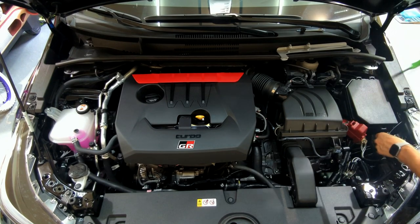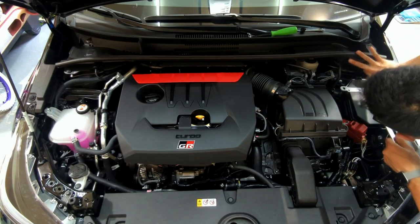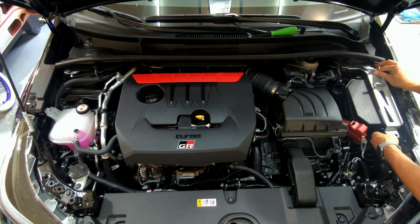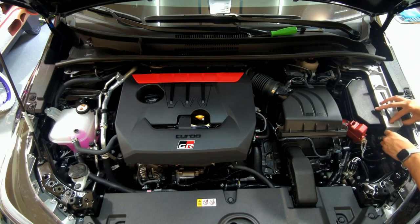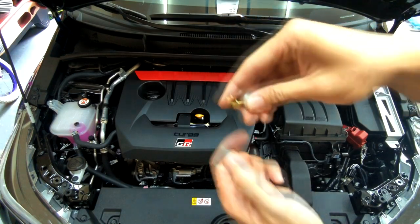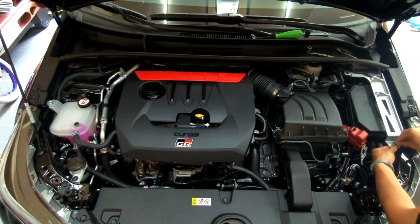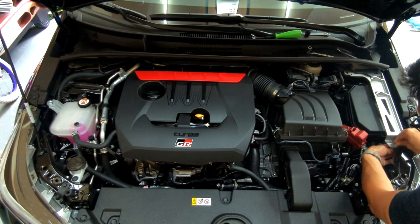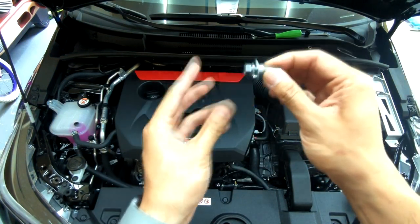It's very stubborn, mainly because I don't think you're even supposed to remove it. This piece right here has a bar attached to the strut tower that's very thin metal — you wedge the bracket right there. Then, once you have the bracket lined up, take the short gold bolt, one washer — it's a 10 millimeter, all supplied — and one of the gold nuts, slide it through where the cable was, take the nut, and start tightening it in. Leave that loose for right now.